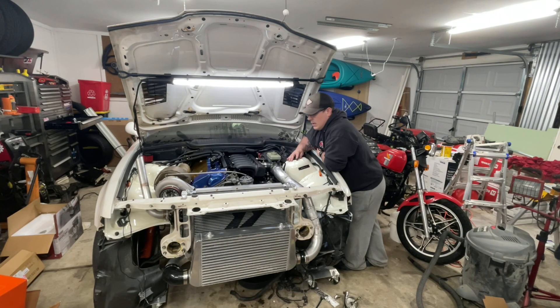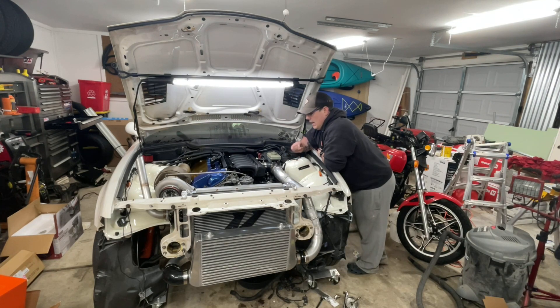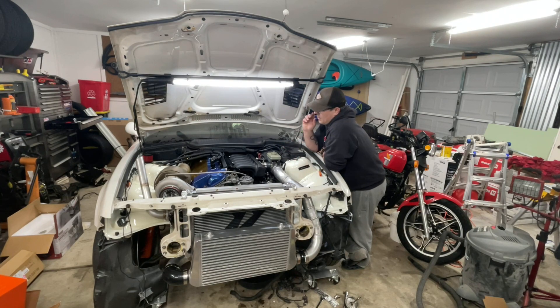But like I said, this is RKTunes as far as the setup goes, so it will be a little bit different. If you do have any questions about it, you can message me directly — either in the comments, on the Facebook page DadBotGarage, or on Instagram at DadBotGarageOfficial — and I'll be able to help you with any questions you may have. Some questions I may not directly know the answer to, but if you ask me I will try to find out for you. As far as the OBD2 swap goes, that is pretty much it. The ECU — you will have to use the ECU that came with the harness. So if you go to the junkyard and find a car that has the correct OBD2 harness and ECU, make sure you grab all of it. That should be pretty much it for the OBD2 swap.